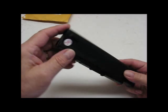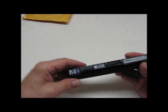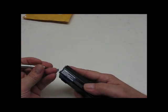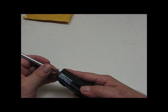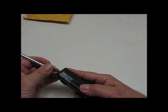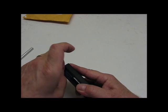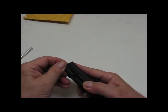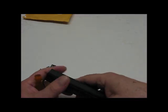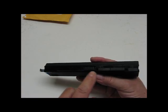We're going to see if that seam is glued or snap fit. I'm going to remove all the labels first in order to get to the seam. You can use your fingernail or a razor blade knife — I'm going to use a razor knife to get underneath the label and start lifting it up, and then hopefully it should pull right off. Yeah, pulls off good enough. So I'm going to do that with all the labels.